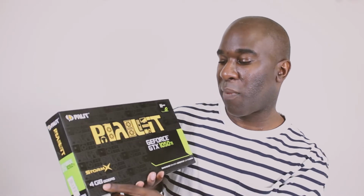Let's talk about this. So it's 2 builds in one video. I'm going to be using a Dark Base 700 case and a Fractal Meshify C. I'm going to be using 2 16 gig kits of Crucial Ballistix Elite, and the other ones I think are a Sport version, but it doesn't have the RGBs in it, just normal. This is for performance. I'm using 2 Ryzen 5 1600X AMD CPUs in case I want to overclock, and 2 GTX 1050 Tis. Now these are made, well, not made, they're obviously made by NVIDIA, but this is the third party, and it's called, I think, Palit. Palit StormX 4GB GDDR5, and these would be awesome for gaming and all that sort of stuff.